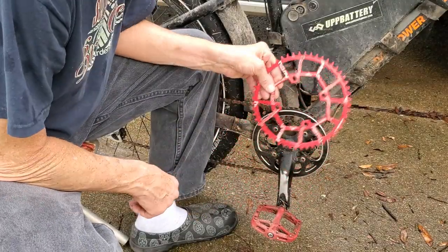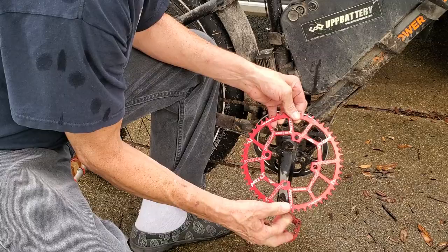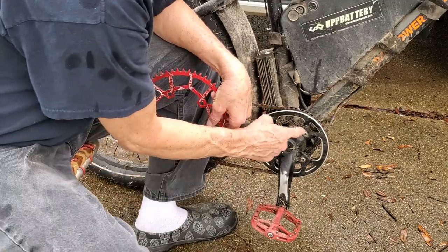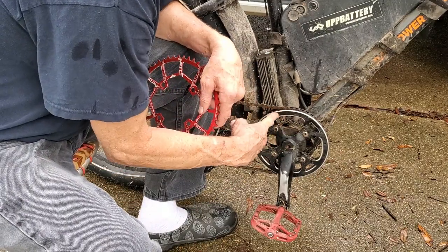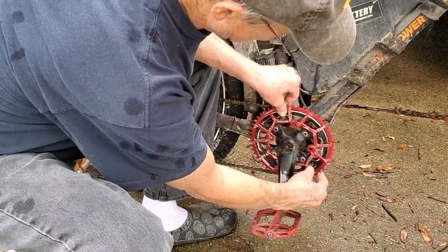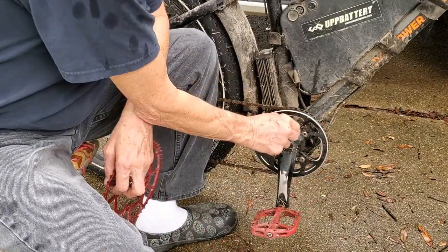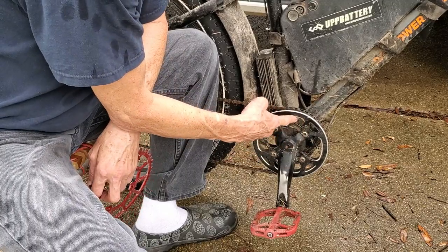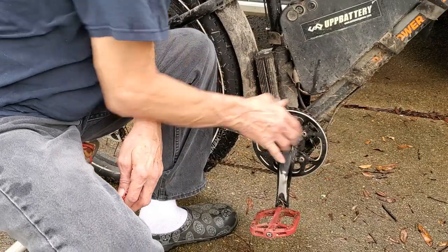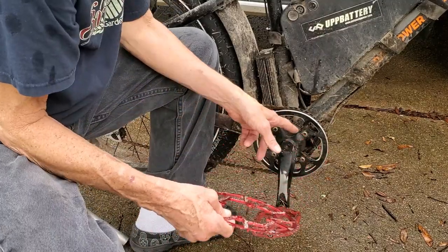Replacing this chainring is really easy to do — there are just four nuts, and the new chainring comes with new hardware. I would use the new hardware with the new chainring. The old chainring also comes with these chainring guards, but you can see this chainring is bigger than the guard, so there's no point in having the guards on here. All they do is collect dirt that you can't get out. They're just there to protect your pants from grease if you happen to lean against the chain — that's all the chain guard really does. So we're not going to replace those.